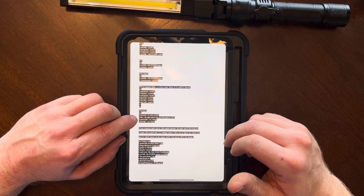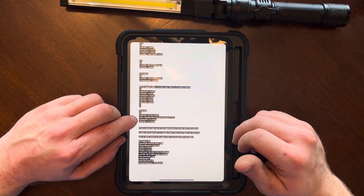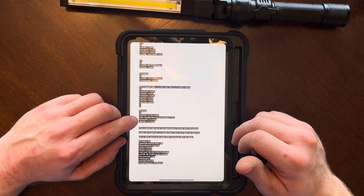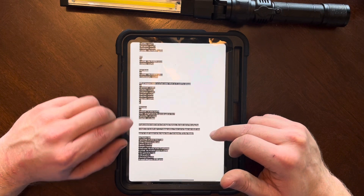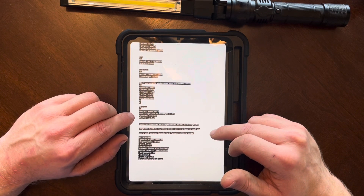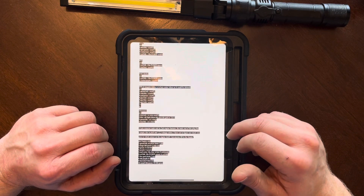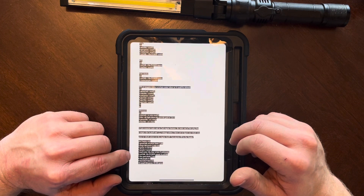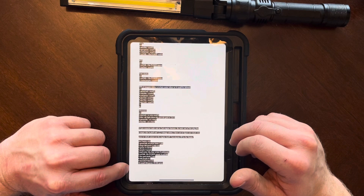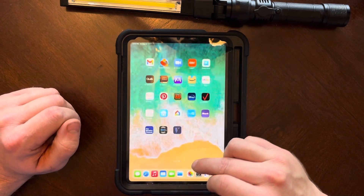Your ECU will be pin 10 and 38 on the brown-red and blue wires - this is the alternator light. I think that is actually your exciter wire on that, but I'm not sure yet - I haven't got that far. If the blue is the exciter, you're going to have to wire a 12-volt for that. If the alternator doesn't charge for you, you will definitely have to wire that in.